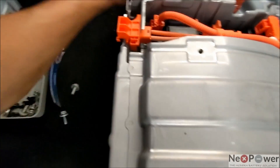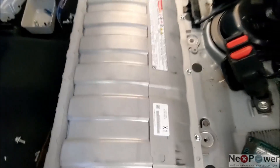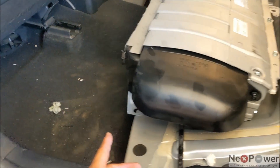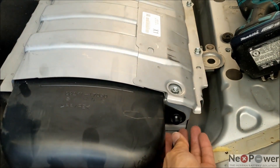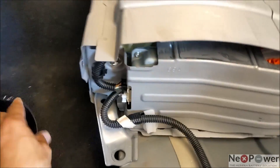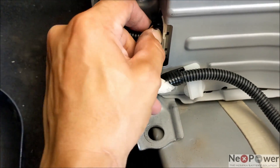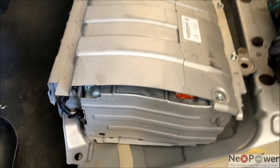You don't want to lose any of the bolts, so keep them safe. Before taking out the heavy battery, there are two additional plugs right over here inside that need to be taken out. There's a screw — bring it up and just slide this out. Two plugs — disconnect them. Now the battery is free to move.